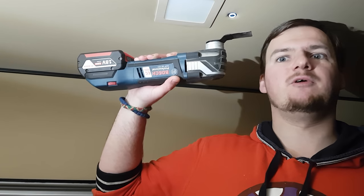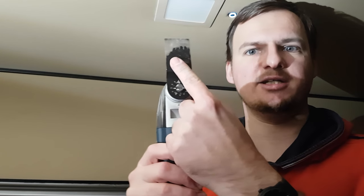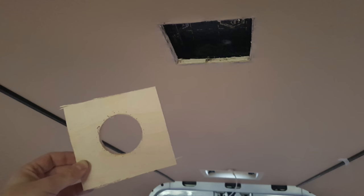For making a hole without putting the ceiling off, which is a very hard job in my van, I took this vibrating multi-tool with this vertical sided blade. With this tool, making square holes is a very easy job and I am able to make it without taking the ceiling off. But if you don't have these tools, you can use the jigsaw machine, but you have to put the ceiling down to make your hole.